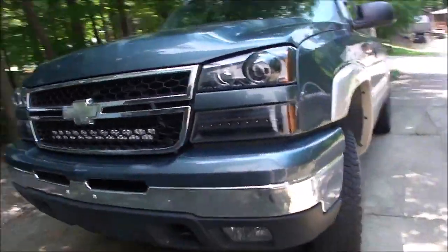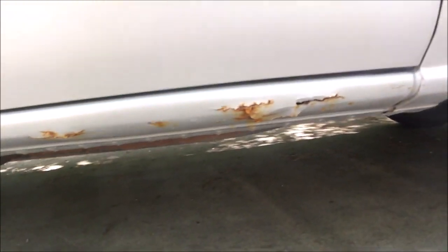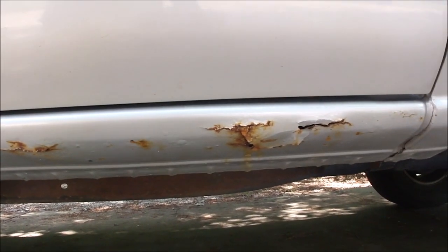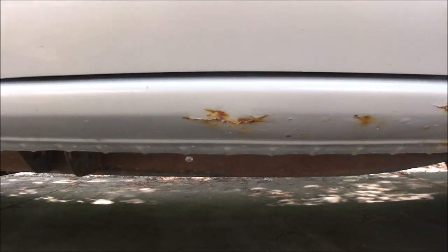We've got the rocker panels painted, have the truck liner on them, and next step is going to be cleaning up the truck, getting the old panel, getting that old rust ground off, and then we'll be putting them on. It's going to be a combination of glue and rivets, and we'll seal the front with some fairing compound, which is really for boats, but it's kind of the filler putty for boats, if you will.